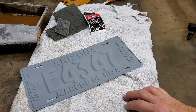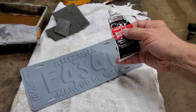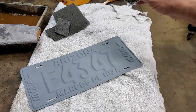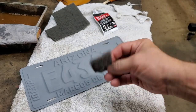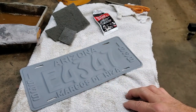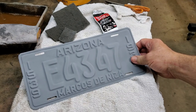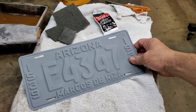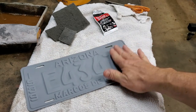It's just a little water with a drop of dish soap. If we found a bad spot where we missed, we used our little spot glazing putty to fill that in and constantly watched for little bits that needed it. Also, when you're working in the letters, it works good to use a piece of Scotch-Brite — cuts easily with your average scissors — and work between the letters to make things as smooth as you can possibly make them. I didn't bore you with all that because it would have been endless sanding. Realistically, it probably took about three hours of painting, sanding, a little filling, back and forth — about six times in order to get this really nice.